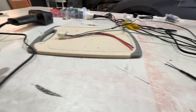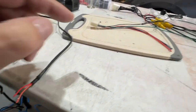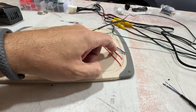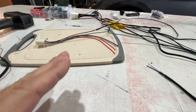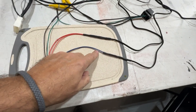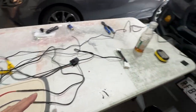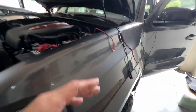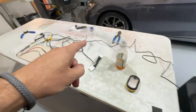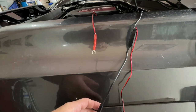That leaves us with a few color-matching wires, which makes it very simple to connect up to the switch plug. On one side — both loomed wires — you have a blue and a gray. On the other side you have a red and an orange. On the switch plug wire you have blue, gray, orange, and red. So you just connect the color-matching wires. Everything is now ready out here to step inside the truck, so I'm going to pull the rest of the wiring inside — all of this is going to go inside the truck — and the camera wire can be pulled to the front.